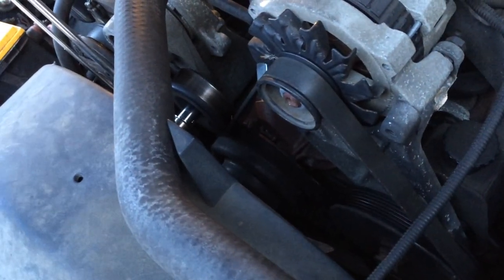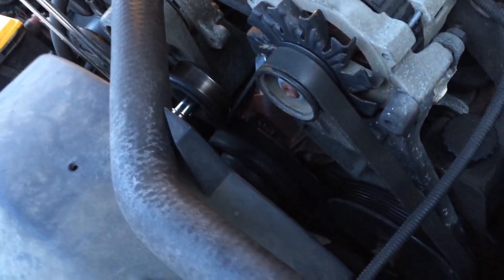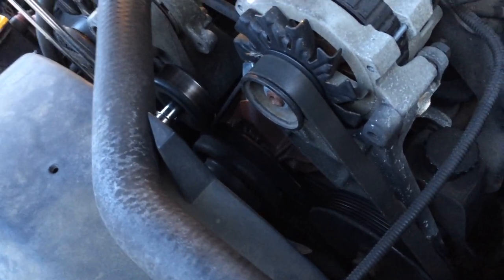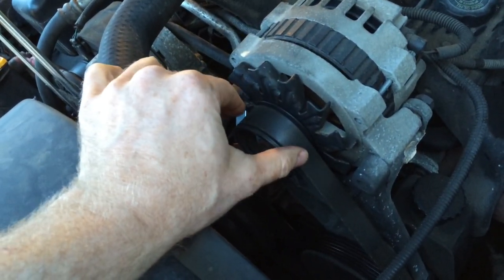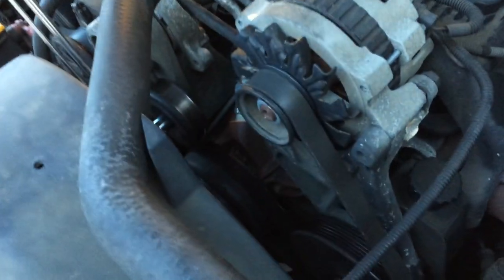When you're buying a new belt, it's best to take the old belt off and bring it in to make sure the new one is the same size. On this truck, some people have a heavy-duty alternator with a bigger pulley, so the belt could be an inch longer or shorter depending on the alternator. There are various other factors as well.